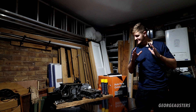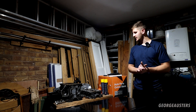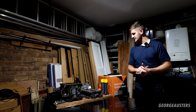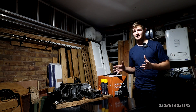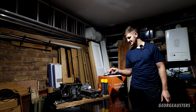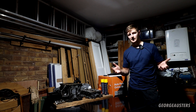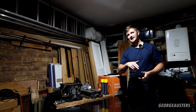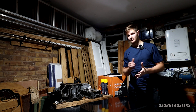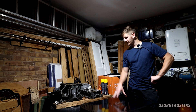Complete engine strip-down done. Was things as bad as I thought? We don't really know for sure yet — we still have measurements to do. We need to measure the cylinders and see if everything is within tolerance. But as far as visible damage goes, it's definitely nowhere near as bad as I thought. I believe this engine block is saveable, and I think all the pistons are saveable too — I can't see any damage on them. We'll install all new piston rings and probably upgrade to three-piece style rings, as that's a common upgrade when rebuilding these engines.